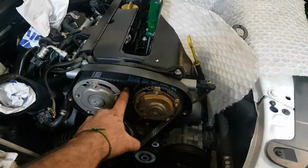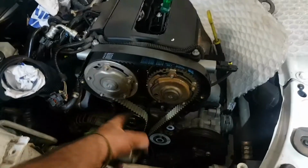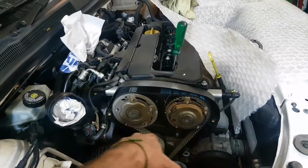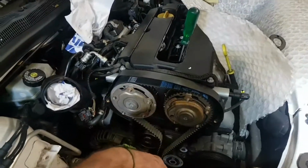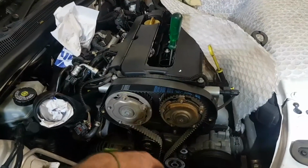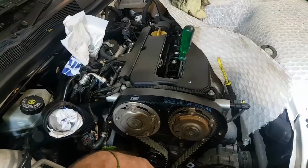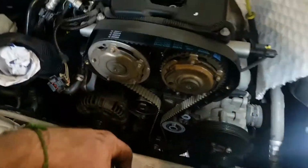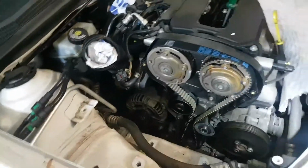So once you get it basically come up with it, put the belt on there, rock it back and forwards from the crank, and then pull the tensioner pin, and now turn the engine 4 times or 4,000 times or whatever you want to do. I always have this for top dead center. It's just a procedure, but yeah, it's not a bad car to work on.